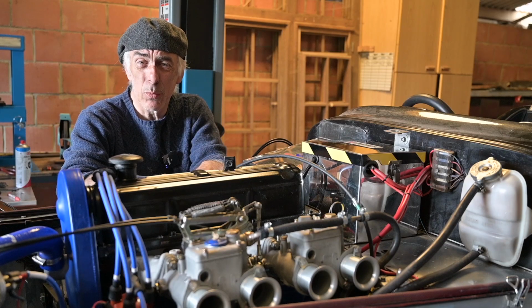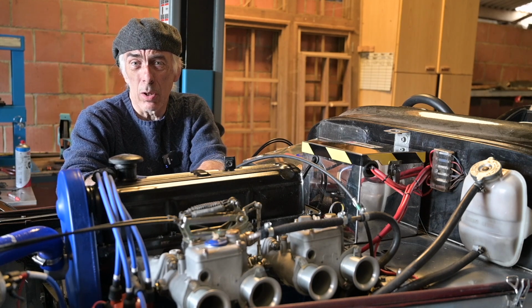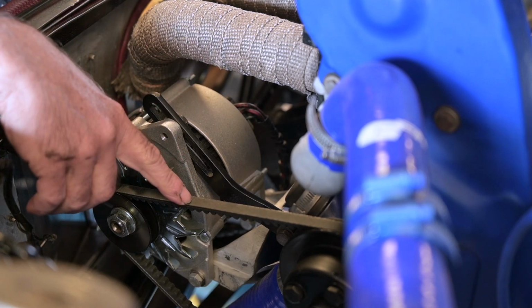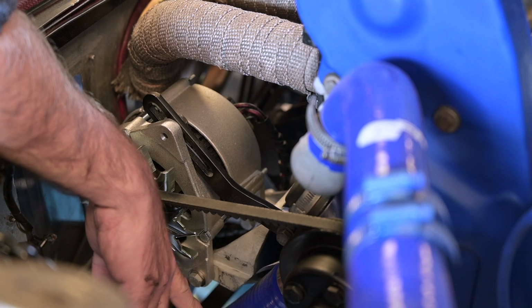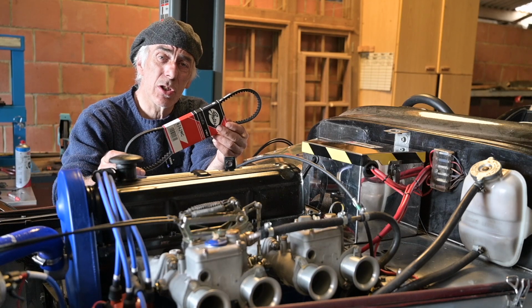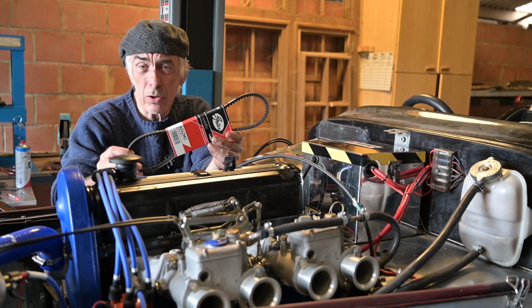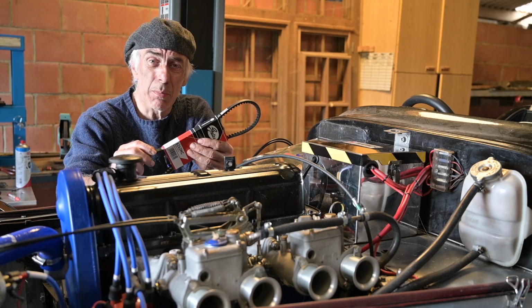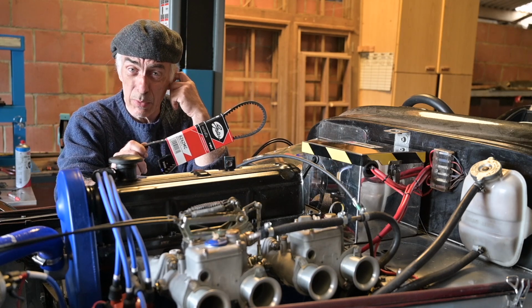And before we start to work on the body of old Sporty, I took some of your advice that you all provided on the previous videos. One of the comments was that the belt on the bottom was very close to the cooling hose, and you're absolutely right. The belt, which is used to drive the alternator and the water pump, was very close to one of the cooling hoses on the bottom. So whenever I was doing high rotations per minute, the belt would jiggle and it would actually touch the hose, which is not a good thing.